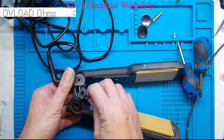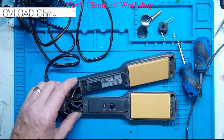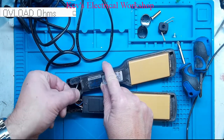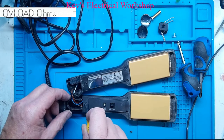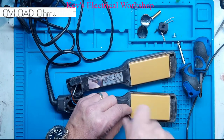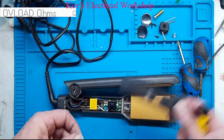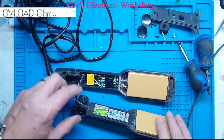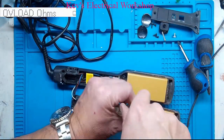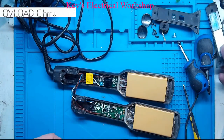Let's take the hinge pin out, then part it, and take the hinge spring out. As I've said in previous videos, I like to take off the cover to give me a bit more lead manipulation. On the SS5 they're a wide plate — there are actually three screws on each cover compared to two on the standard models. There's one cover off; let's do the other cover. Second cover off.